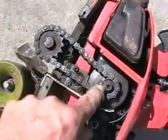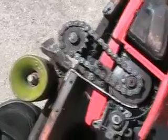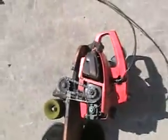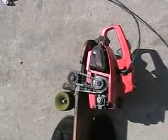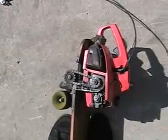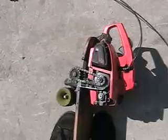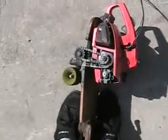The ratio from the output shaft calculates out to be three and a quarter — three and a quarter RPMs here to one RPM there. This thing goes pretty fast, about 42 kilometers an hour. So when you fall off at 30 miles an hour it really screws up your knees. That's why I've got the coaster clutch in there, so there's a little less chance of falling off because it doesn't decelerate very quickly.